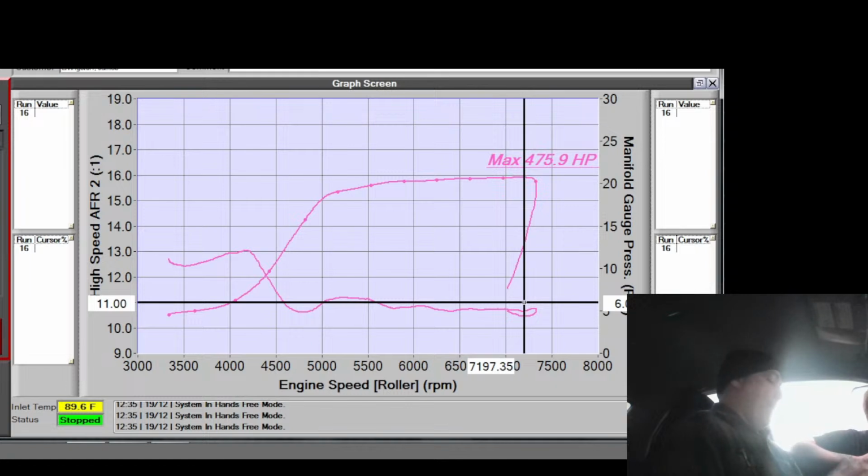Honestly, the power steering could be spun up a little bit. I mean, higher RPM it is, but just in general, even a slightly smaller pulley for the power steering pump would be cool. So you could underdrive the alternator, but overdrive the power steering pump. Yeah. Because the newer cars have such heavy steering. You get in a GD and you're like, ooh, this is nice, and then you get in a VA and you're just cranking on the wheel to get it to turn.